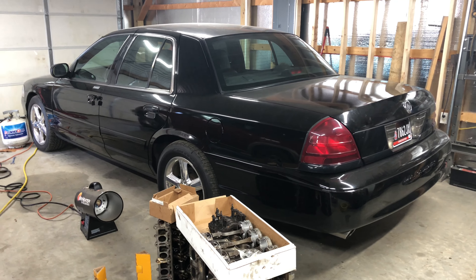From the back of the vehicle it didn't look too bad, but when you get up here you can tell how serious this was. Let me get up here to the core support - you can see how hard of a hit this thing actually took. Just behind the hood latch there's a peak in the core support, and that peak shouldn't be there. This whole front end shoved over about six inches. It doesn't appear that the frame is too bad, but I can tell the ends of the frame are swayed over, so there's definitely some frame damage that's going to need a visit to the frame rack. We'll have to do a light pull on the front end to get the ends of the frame rails back over. Obviously hood, fender, headlight, bumper cover, the impact bar and the absorber - all that stuff is damaged. Everything forward of the doors is going to have to come off.